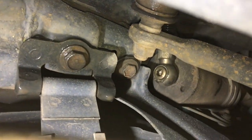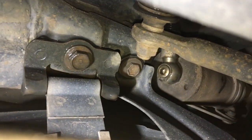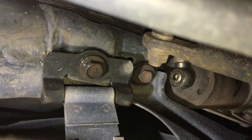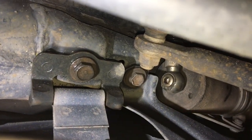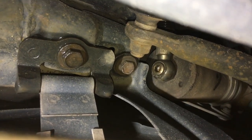There you go, middle of the picture with a bolt. Right, not the one on the left. You want to drop the whole fuel tank strap. You want to do the one a bit higher up. You can see, middle of the picture, right in line with the end of the sway bar link. Right, that one there. And then there's one, two, three in a row.